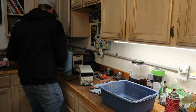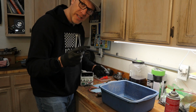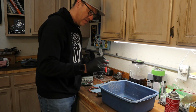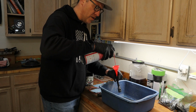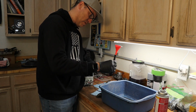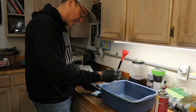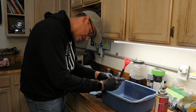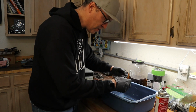Now that way didn't work very well, so I'm going to try something a little different. On paper it sounded good. So now I've got just some low pressure fuel line. We're going to put it on the pencil, and I've just got a little funnel. I'm going to load this up. And now this way I can act as the switch to open and close the injector. I'm just going to touch the one lead until all of that is gone, and then go through all the injectors.